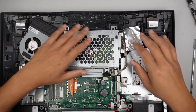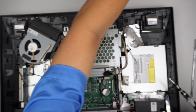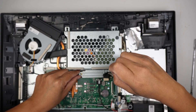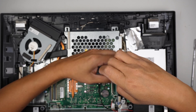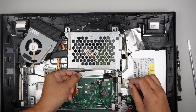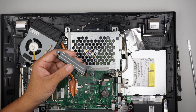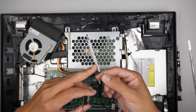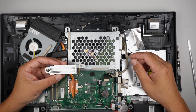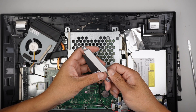Here's the hard drive. I'd like to remove this hard drive as well as the M.2. It's a little bit tricky to remove because they have thermal pads — this thermal pad is stuck onto the RAM. You want to lift it at a 45-degree angle and slide it to your left. This is the 256GB M.2 SSD drive. If you want to upgrade to a larger one, you can.